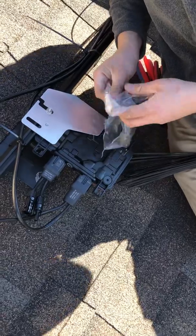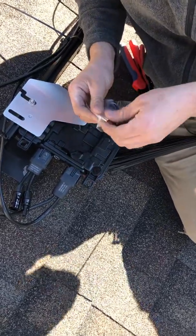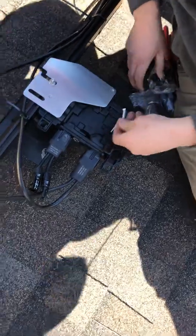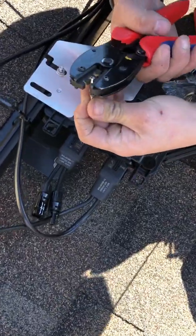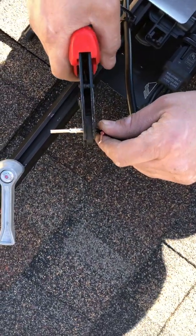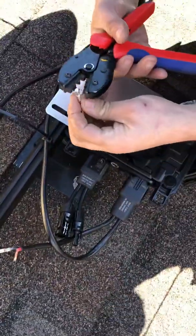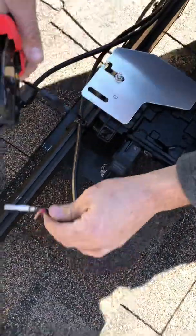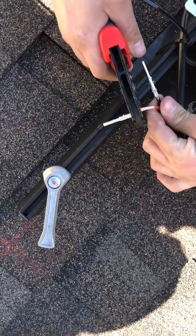Open the package and take out the pins for the male connector. Put it into the 12 side of the crimper and crimp. Gather the strands together a little bit more — they're looking a little frayed.